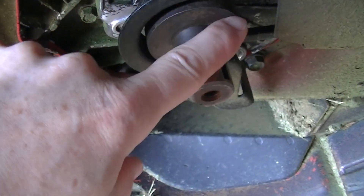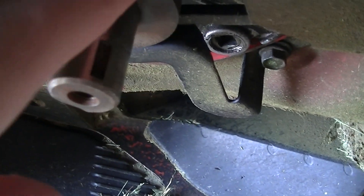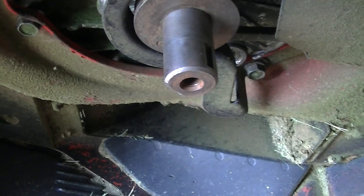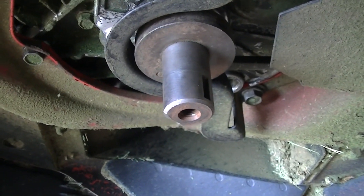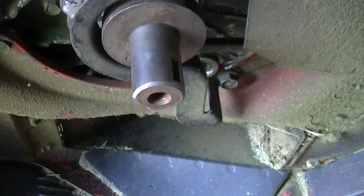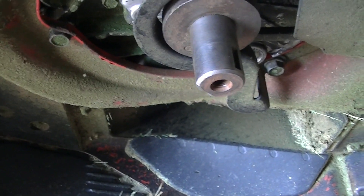These are guards here for the self-propel, and here's the pulley. There was a feature on this crank that was more of a keyway, but I was able to put a set screw right up there and just push that in. This is one of those personal pace mowers — it's really nice. I really like how it works because the faster you walk and hold the handle, the faster it goes. It literally adjusts to how hard you're pushing on the mower handle for how fast it goes.